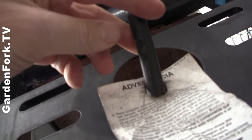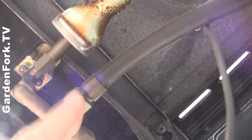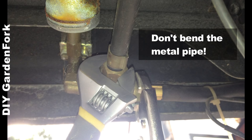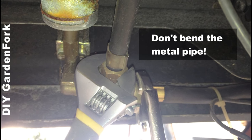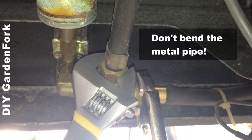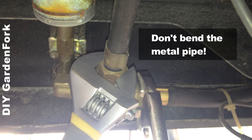Your regulator hose comes away from the tank and goes up and into the grill, and we want to disconnect that hose right here. Use an adjustable wrench, loosen this, and it comes off. Use a vice grip style locking plier on the gas pipe that the regulator hose goes into — just be careful not to torque and twist that too hard. Gentle pressure and take it off.